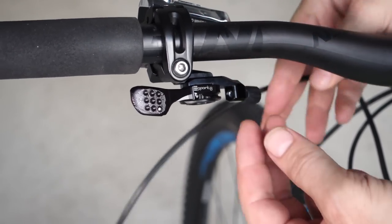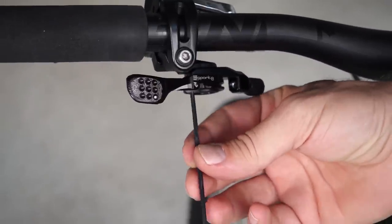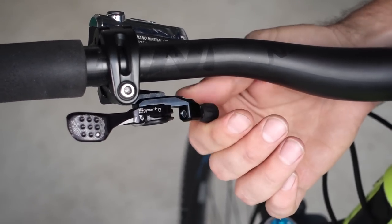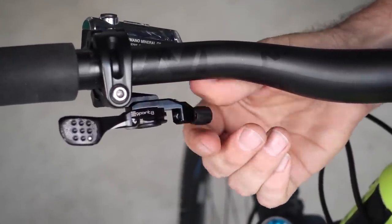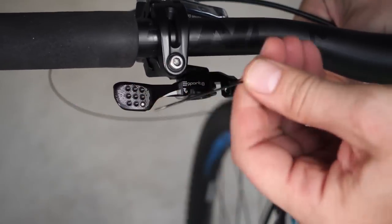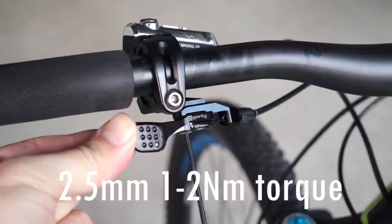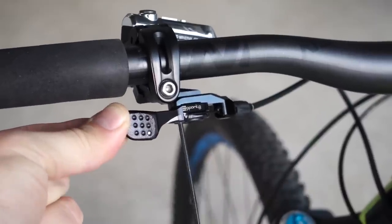Finally, before you feed your cable through, just use a 2.5mm hex to unscrew the cable set screw a little bit - just make room for your inner cable. Then take this barrel adjuster and turn it clockwise all the way in, then 1, 2, 3, 4, 5, 6 turns out. Fit the cable through, and as you push it through the barrel then push it here into the lever. Last thing - put a bit of tension onto your cable, then use the same 2.5mm hex and tighten your cable here.